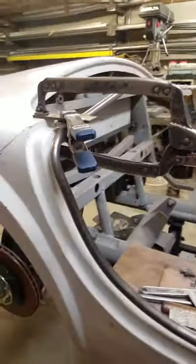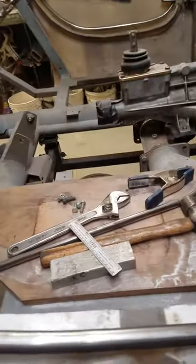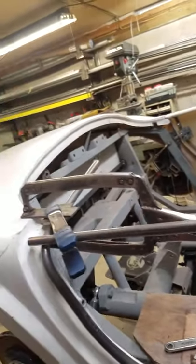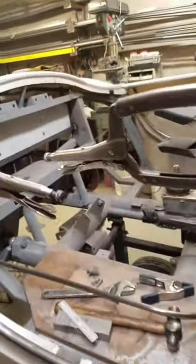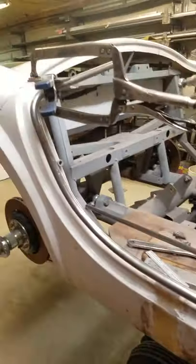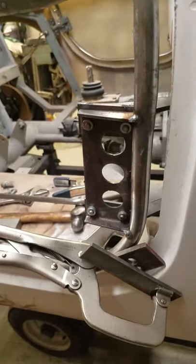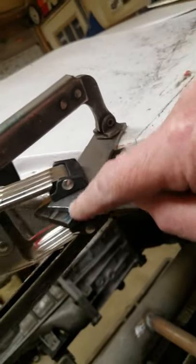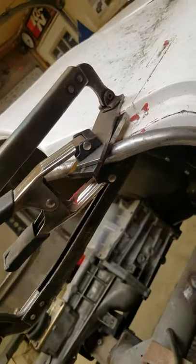Two main pieces of a door frame. We've got the long piece at the bottom and the shorter piece at the top. What I do is I bend up the bottom part of the door frame and get that mocked up — like you saw on the trunk — where I get that as close as I can to the opening, where things like the hinges and the front of the tube are all fairly parallel to the opening I have to work with. You can see I've done my same trick where I clamp a plate to the bodywork and put a shim behind it to simulate the thickness of the skin that's going to be put on there.